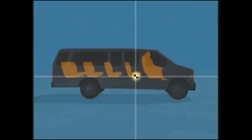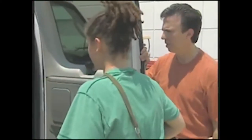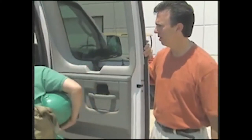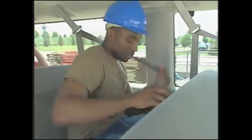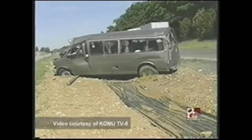As more people fill a 15-passenger van, the center of gravity moves upward and toward the rear, making it more likely to roll over. It also makes the van handle differently from most cars, increasing the chances a driver will lose control, especially when reacting to unforeseen circumstances like being cut off. NHTSA found that rollover risk increased significantly at speeds over 50 miles per hour and on curved roads. Safety belt use among occupants is very low compared to other vehicles, increasing fatality odds. Driver age was less of a factor than experience; a majority of highly publicized crashes involve inexperienced drivers.